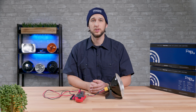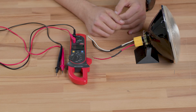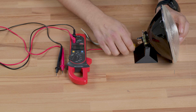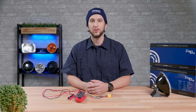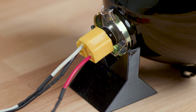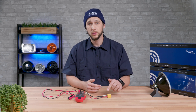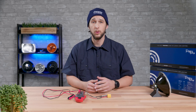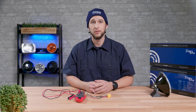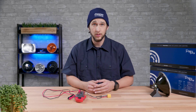So now that we've verified battery voltage, we are going to check the voltages at the H4 headlight plug. We'll go ahead and unplug the H4 plug from the back of the headlight. The H4 plug is what came standard on almost all US spec cars with sealed beam lights, but the principles of testing the plug will be similar on modern cars as well. You will just need to verify which wires are low beam power, high beam power, and ground. For the H4 style plug on two headlight cars, it's simply a three wire input of low beam, high beam, and ground.